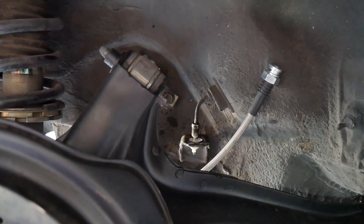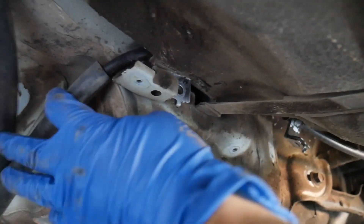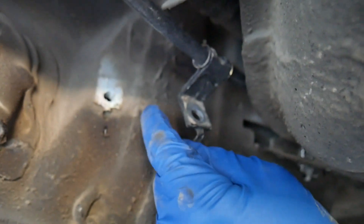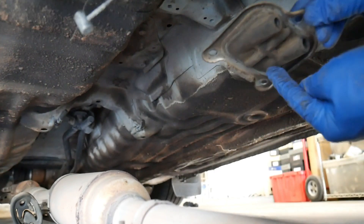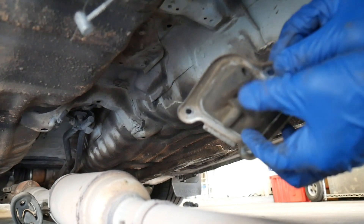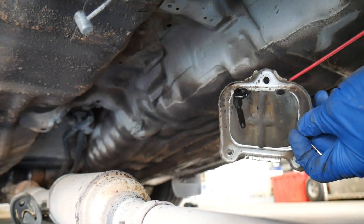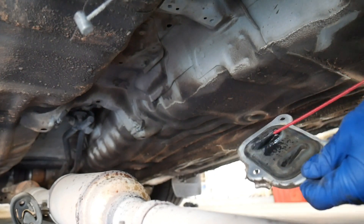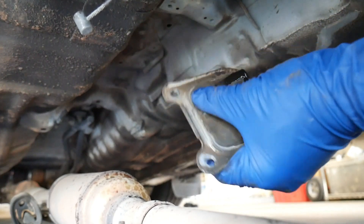After both trailing arms are installed, let's get the e-brake cables fed up into the chassis. Feed both e-brake cables over the gas tank straps — this is how we're going to remount them. Install both the passenger side and the driver side cables, then tighten up all four 12 millimeter bolts which hold the brackets in place. Next, get the e-brake cables back into the bracket. Assemble it so that when you bolt it back up it goes straight up and the cables go into the rubber holes. The easiest way to get them installed is to put a bunch of WD-40 on them and the cable will just go right into place.